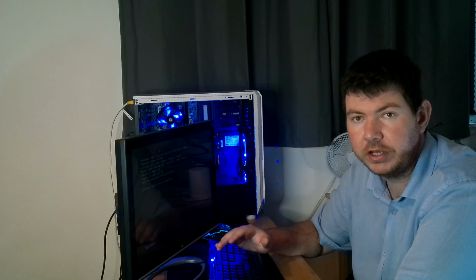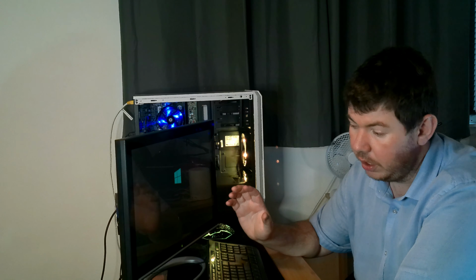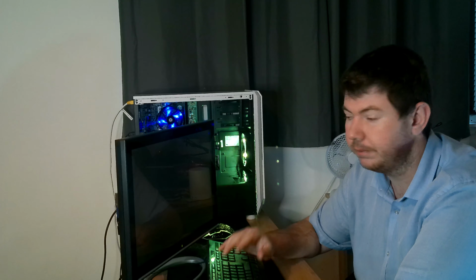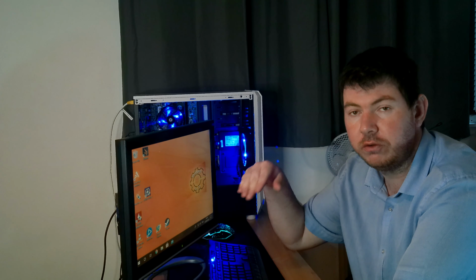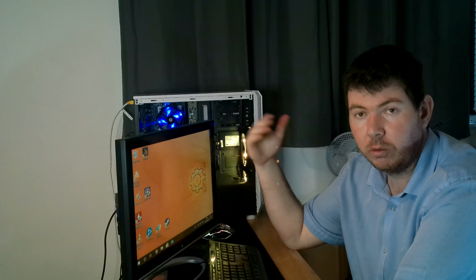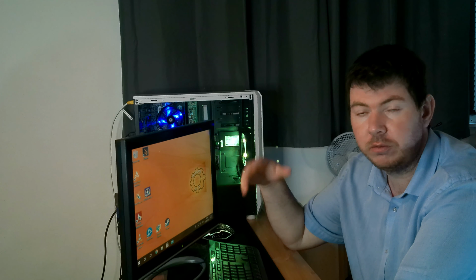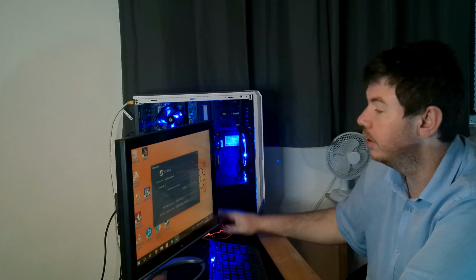Now, just to recap, we did a GTX 980 in my brother-in-law's PC. Ran smooth. Took that same card, I put it into this rig. It shuts down the moment I do a benchmark, right? Installed a new power supply, or at least to feed the graphics card externally with a different power supply. It was a 700 watt. It supported 2 8-pins. I only had to convert my one 8-pin to a 6-pin, right?